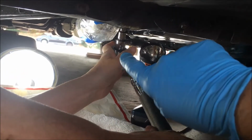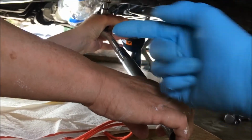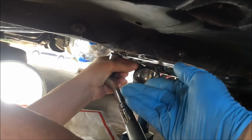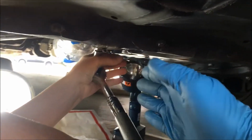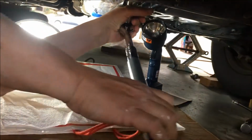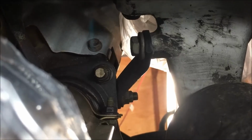Okay, what y'all need to do, she's gonna keep that hand. She's using her right hand to pull the ratchet this way. She's got a cheater bar on it. With her left hand, she's keeping the head of that ratchet up and forcing it and pushing that way. You need opposing forces or you're gonna break something. So watch her do it, y'all. There you go. She broke it free. She's a strong old bird, y'all. All those nuts up there on that exhaust are now loose.